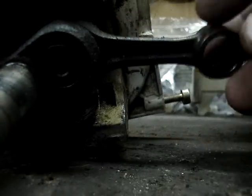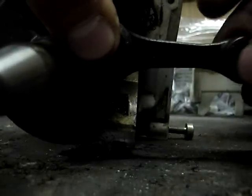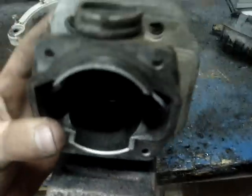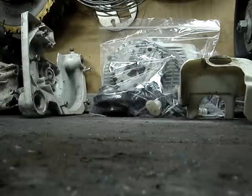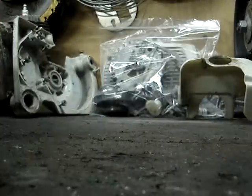If you can see, right here is the connecting rod. I'll try and show you — as you can see it moves back and forth, but you can barely see it moves up and down and the bearings are shot. The piston rings were cooked in it and the piston is shot. You can't really see it, but that is bad. He wants me to order the parts and put that all together. So that's what I've been doing right there.